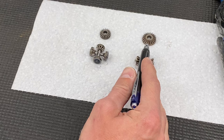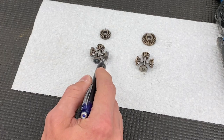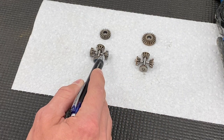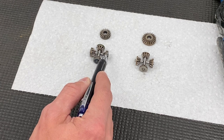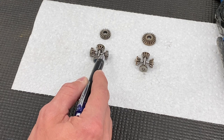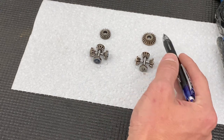When we come over to the LTC gear diff, we have a smaller sun gear and different looking planet gears. We have less teeth here, less surface area compared to the HTC. On the LTC you have more of just metal and then a sharper, steeper diff gear angle. So you have less contact patch with your sun gear than on the HTC.